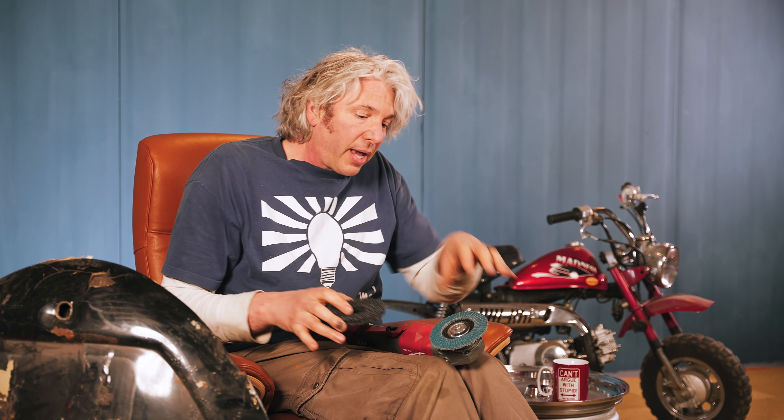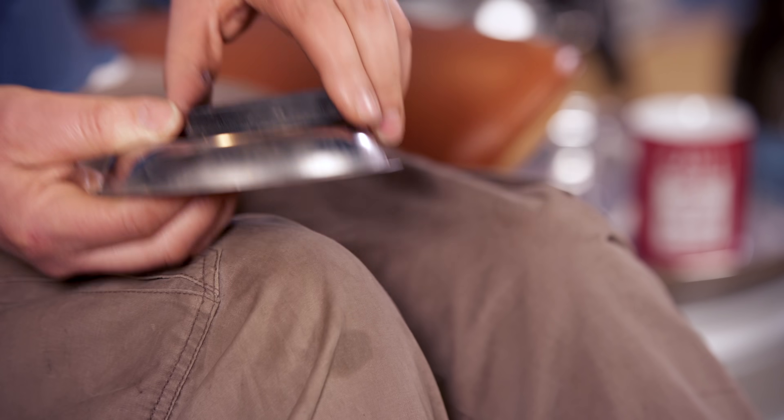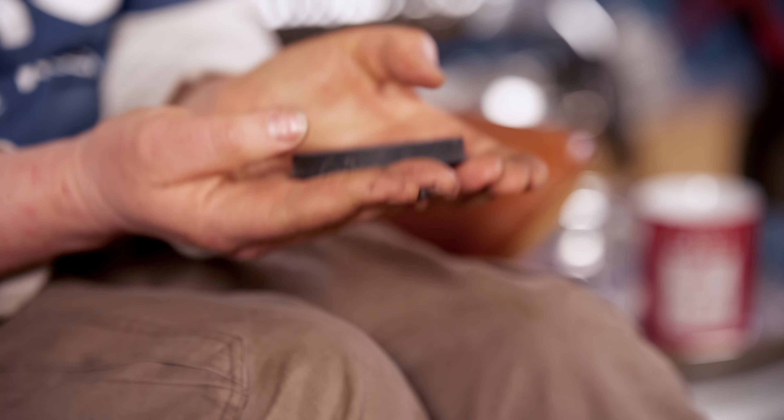To do a slightly lighter job you can also get hard abrasive sponges — great for removing light rust and paint. A final handy tip when playing around with repair panels: get yourself a little magnetic tray, or just buy a magnet, and use that to hold your repair patch onto your original bodywork. That way you have your hands free to do the welding. I'm going to be getting very familiar with repair panels when I come to tackle the ridiculously poor bodywork on the Range Rover.